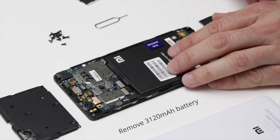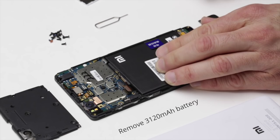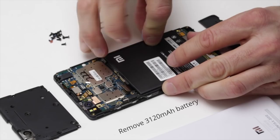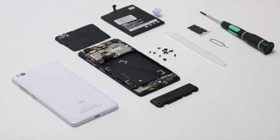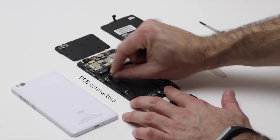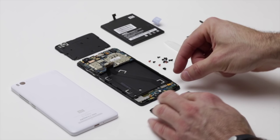Next I'm going to go ahead and remove the battery. I've already disconnected the battery connector, so I can just pull out the battery and it comes out. This is the 3,120 milliamp-hour battery — it's made by Sony and Samsung. You can see here that we use two wires, which are fairly delicate expensive components, to connect the top motherboard to the bottom board. The goal of having two motherboards is so that we can have the USB as well as the speaker, which comes out through the grill on the bottom of the device.